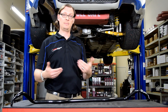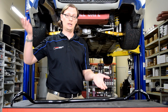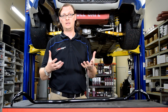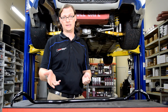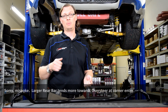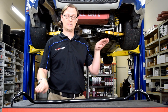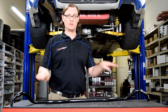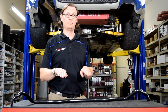When dialing in sway bars, it's generally better to do both front and rear at the same time, unless you're really trying to over-correct one end of the car. Generally speaking, a larger front sway bar gives better initial turn-in at corner entry but makes the car more prone to understeer at corner exit. A larger rear bar makes the car more prone to understeer at corner entry but more neutral or tending toward oversteer at corner exit. You don't want to stagger the bars too widely because they can have really opposite effects at corner entry versus exit. Staying in the same ballpark and using the fine adjustment on the end-links to dial in the car's tendencies is the best approach.